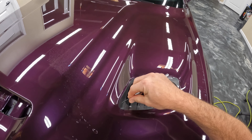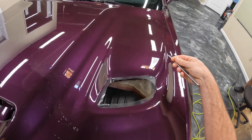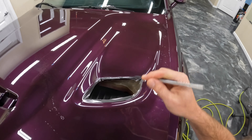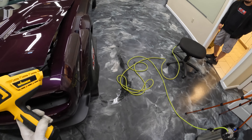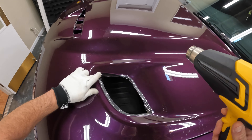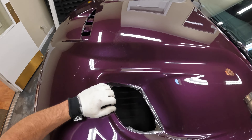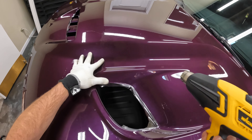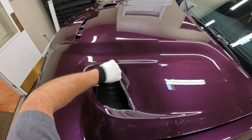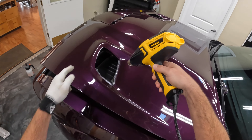Let's move on to this vent here in the hood. I'm going to cut it in basically all four corners, and that's going to help relieve a lot of the tension on the material so I can wrap it to underneath the hood. We went ahead and did that little splice, then put some heat on it and wrapped it around underneath the hood. You could trim it off right there at the edge, but I've found that with these vents, when you put them back in, they'll sometimes rub and end up bunching the material up and causing it to pop up. Wrapping it under and sticking it to the bottom side of the hood eliminates that potential problem.